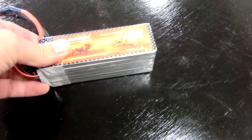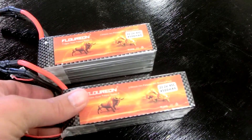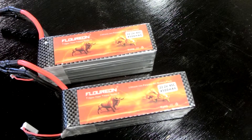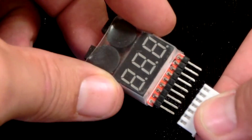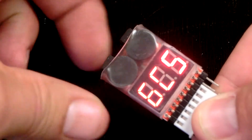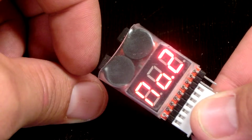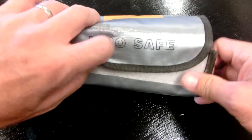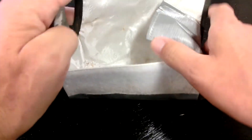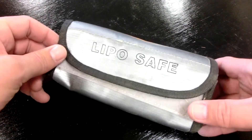You're going to need LiPo batteries — I'm using two 6S 4500 mAh batteries. Hooked in parallel, they'll give us exactly 9 Ah. You'll also want a low voltage alarm, which can be used to test your batteries but is mostly used to sound an alarm when the LiPos get low on power. This is important because you don't want your LiPo batteries to discharge too much. Also grab yourself a LiPo safe bag just in case — most LiPos fail while charging, so keep them in the bag while you charge.